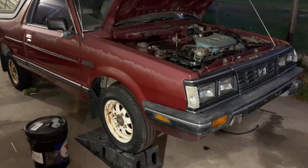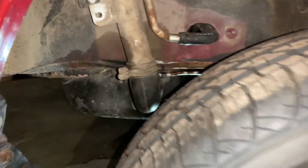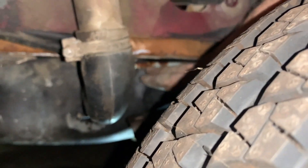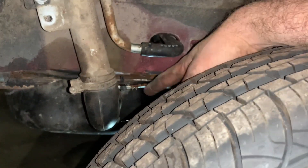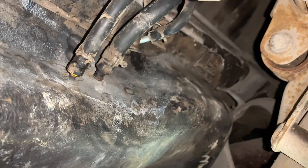The time has come. The gas tank is in the car. We got it back from Watkins radiator this morning and I picked it up after work. This line is going to need some clamps, and the lines down here — there's some vapor lines — they're going to need some clamps as well. But those are just vapor lines, so for testing purposes they're going to be okay. We're going to go do a test drive, hopefully. Everything that has raw fuel has good clamps, so we shouldn't have any leaks. We're going to check all that before we go. Everything's hooked back up, tank's back in, and we're going to give it a shot.